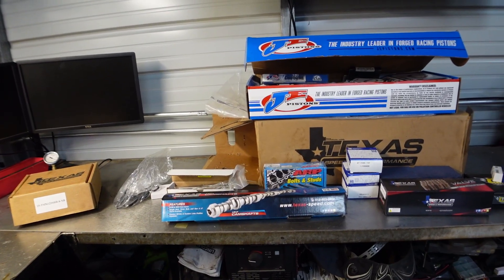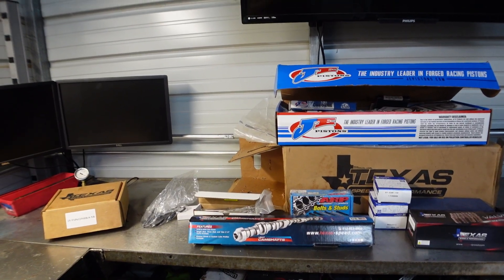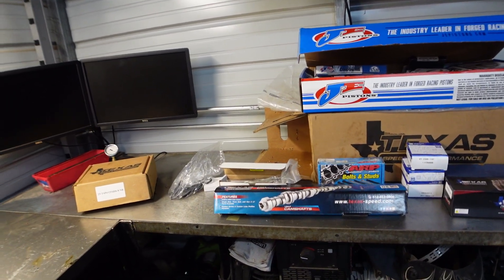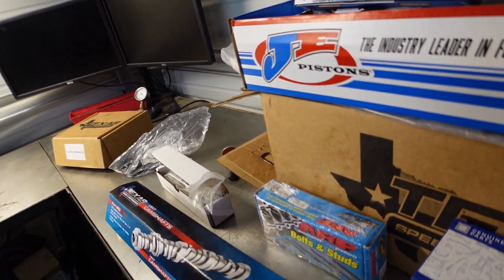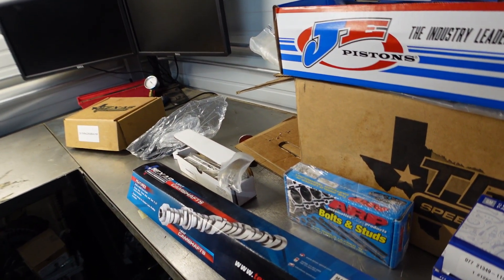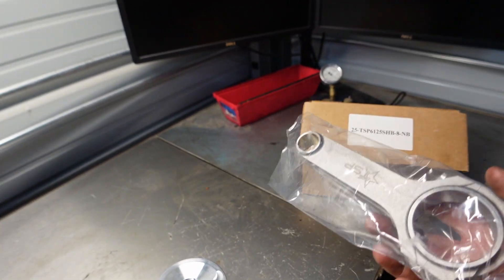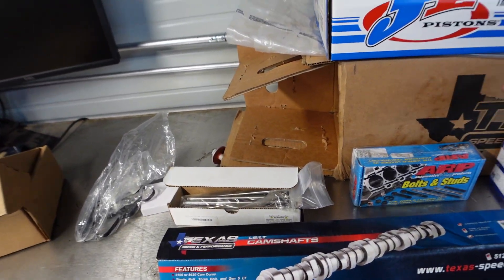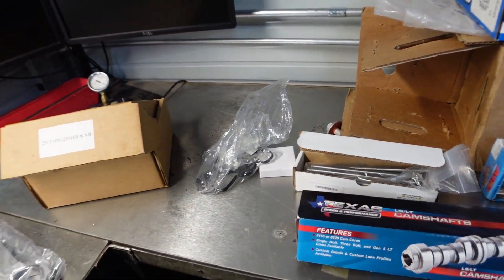We're going to be doing pretty much a whole body-off frame restoration, air ride, custom front suspension with rack and pinion that we're going to build on the CNC table. It's going to be an awesome truck, so stay tuned for that. This kit right here for the LT6.2 is the Texas Speed drop-in kit. What this is, is a kit where you don't need to balance the rotating assembly to put it together — they make it all with GM specs, so it's a drop-in kit. Now the LT that we got did have a spun rod bearing, so we got a brand new GM crank from Texas Speed. I really like their stuff — this is not a sponsored video, this is all bought by us.